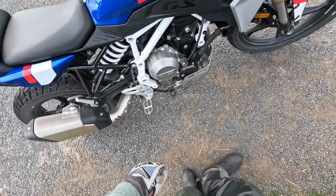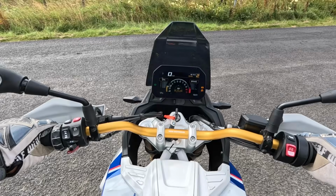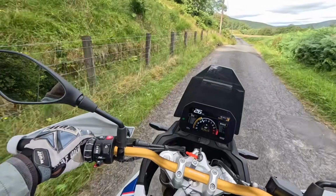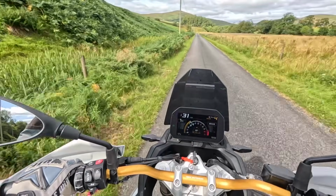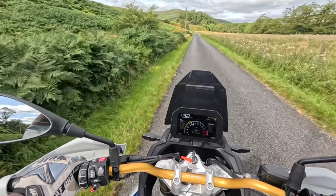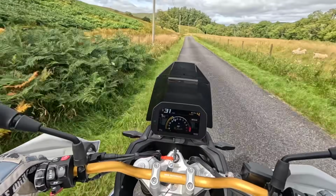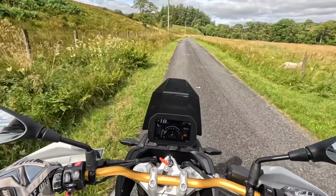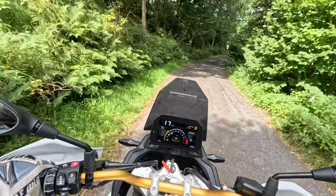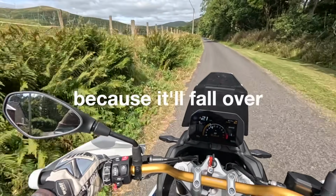It's a pretty decent bash plate. Oh, could I put that in without touching the clutch? Yes, I can. 2, 3, 2. So just to remind myself, pushing it around, if it's in gear, going forwards, it does eventually encounter some resistance and it's hard to push. Arguably that would eventually hold it facing downhill. That same effect does not appear to occur in reverse. So in other words, you can push it backwards in gear until the cows come home. But I mean, I don't know, it's counterintuitive, isn't it? You don't want to be pointing a bike downhill when you park it.